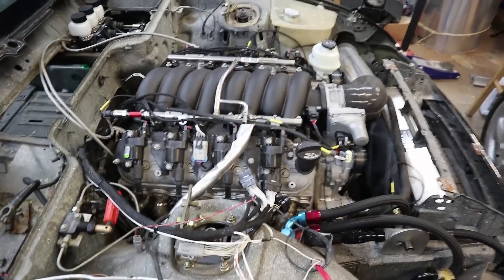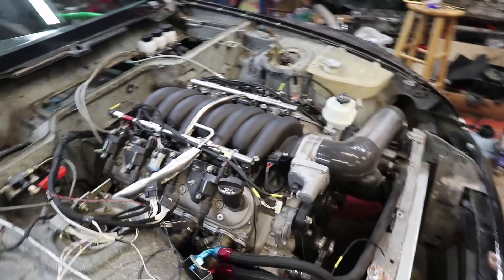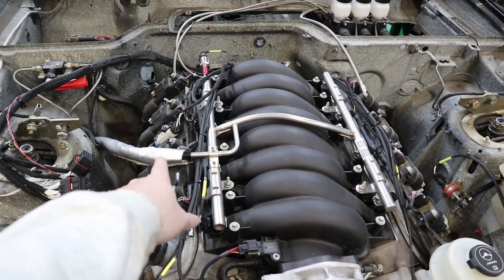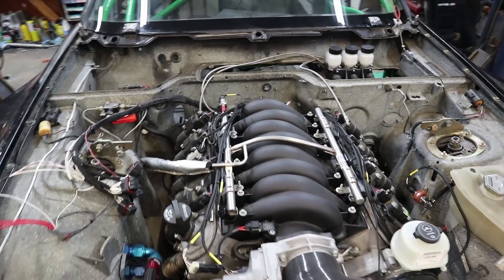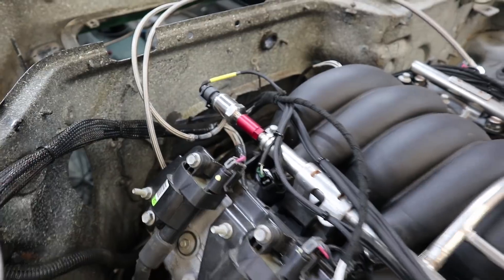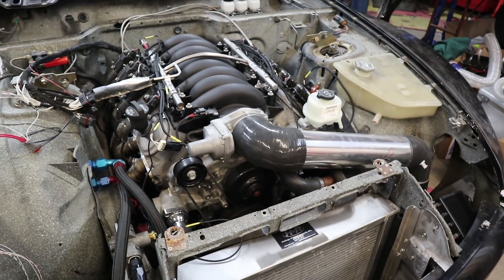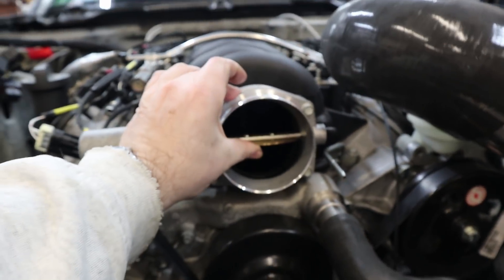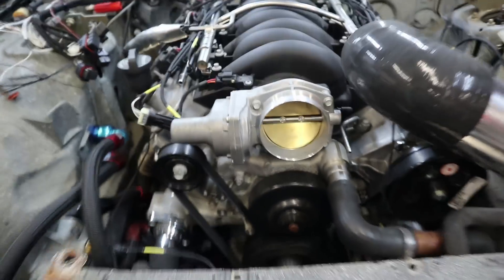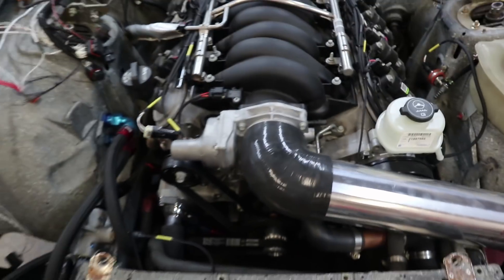The LS3 is physically in place. We're working on the wiring harness right now and the fuel line is plumbed up. We switched the fuel rail — originally the fuel input side was on the other side, but it was a symmetrical part so we were able to turn it around. There is a fuel pressure sensor on the back of the fuel rail. This is a drive-by-wire car, so it has a servo actuator for the throttle body rather than a conventional throttle cable. It still has a conventional throttle body — it's just computer controlled, with the ECU opening it based on inputs including throttle pedal application.